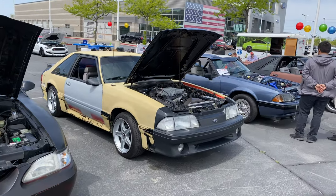We've got Shane here from the 89 Garage — check out his channel. This is Frankie, his '88 GT. He picked it up in June of 2020 as basically a roller — it had the bottom end of the motor but the top end was gone. He went to the wrecking yard and pulled the top end off a Ford Explorer: GT40P heads and the Ford Explorer intake. He put in an E303 cam with a Trick Flow spring upgrade, a '94-'95 H-pipe, and FlowMaster mufflers. It's been a lot of work.